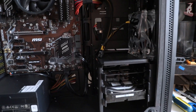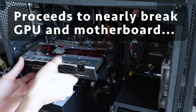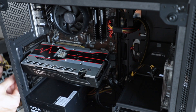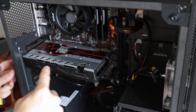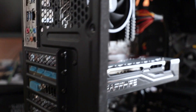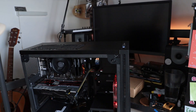Just got the graphics card to put in. I did a little bit of cable management so it's not too messy, and I've put the hard drives in as well. No one tells you about this bit — the GPU goes in like that, but I'm an idiot: I hadn't realized you have to take the back expansion slot cover off first. I nearly broke everything. Tip to beginners: unscrew the back cover before trying to insert the graphics card.